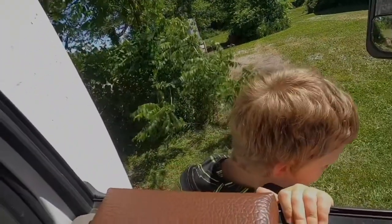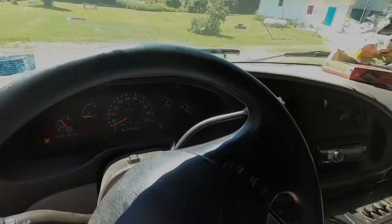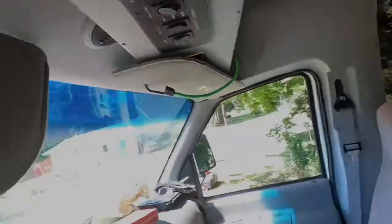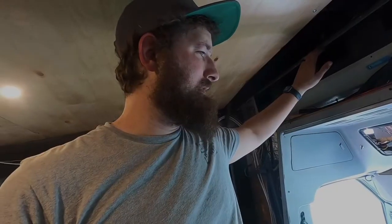Now the moment of truth. We've got to see whether or not these fans are what keeps the AC going and getting colder. It's been about five minutes of running and it definitely seems like it's a little bit cooler for sure. But we had noticed that before too — what had happened was it seemed like it would get kind of cool and then the compressor seemed like it would get clogged, because the fans weren't running.